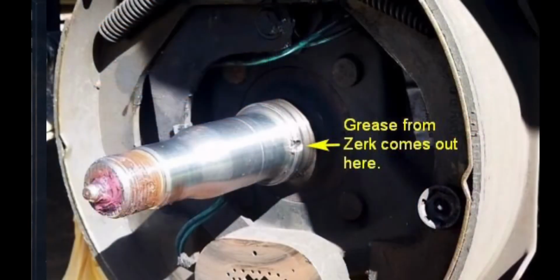There are guys and gals that you'll talk to that say don't use the auto grease port. With the auto grease port, you just hook the grease gun into the grease zerk right there on the front of the hub. You don't have to take everything apart, and you pump grease in. In the middle of the hub, it's hollow, and then it's got openings on the backside, and so as you're pushing grease in, that grease is coming out of the backside, filling the hub with grease and pushing the old grease out. That's how that works.